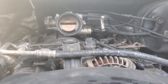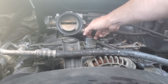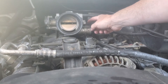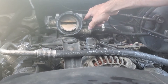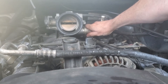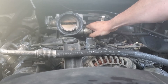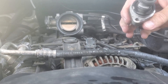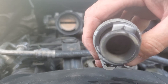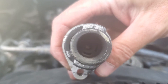I stand corrected — there is only one bolt holding it on at the bottom. I thought there was another one on the top but there is not, so I removed the valve above. I have to figure out what that is — if you know what that is, let me know in the comments. Basically it's in there tight and you just have to wiggle it, loosen it up, and pull it out. You're going to see in here that I have a lot of carbon buildup, which is exactly what I was expecting.